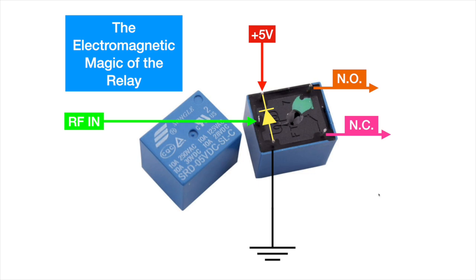How the switching will occur: the way I would usually do it is take a physical switch and break the ground connection. It's the ground connection — once you complete it and current can flow through — that actually does the switching. If you can break the ground connection you control whether the relay is grounded or not. All we do then is remove that wire, have a wire going from the ground pin of the relay to your switch, and just ground the switch. Once you do that, you'll ground the relay and the switching action will happen.